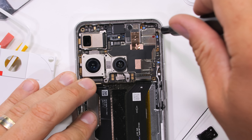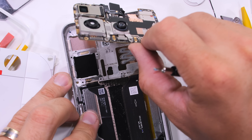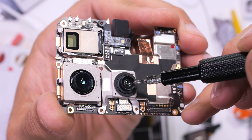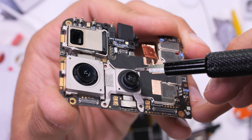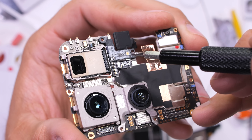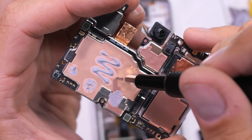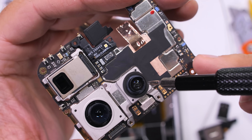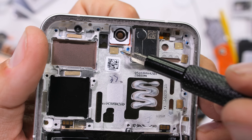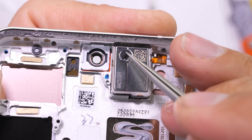Moving our way up to the motherboard, there is one more cleverly camouflaged black Phillips head screw in the upper right side. After that, the whole thing can lift up and out of the frame. The motherboard does indeed have a clean rectangular cutout for the 50 megapixel telephoto periscope camera. The main 50 megapixel camera has optical image stabilization, but the wide angle does not, which is normal. The periscope camera also has internal optical image stabilization. The motherboard has a squiggle of thermal paste on the back of that Snapdragon 8S Gen 4, and we also get a look at the 50 megapixel front facing camera. The processing heat transfers through the thermal paste to the large vapor chamber, and then both to the frame of the phone and out through the front of the screen. The upper earpiece doubles as a loudspeaker.